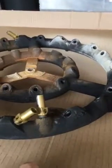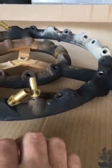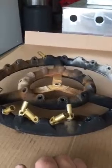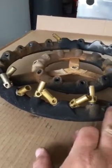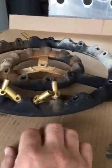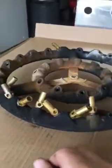I went in and tapped every one of these holes with a metric tap, so the threads are right going back in and they'll take the JB Weld well with good threads. I guarantee it'll probably last twice as long as the original version. They do put some type of setting material on these jets at the factory, but it's real weak stuff — when I pulled this thing out I was actually able to unscrew these by hand. Anyway, it's a quick fix — if you have the same problem with these burners, a couple tubes of JB Weld for seven bucks and you're good to go.